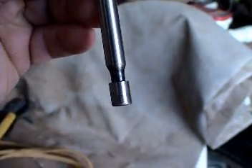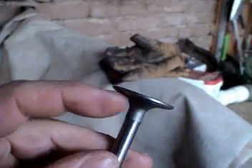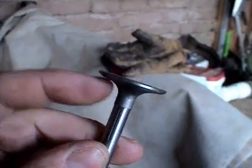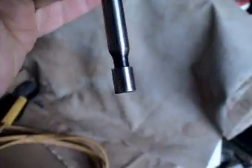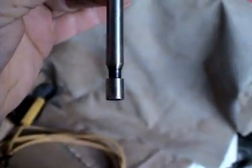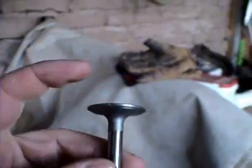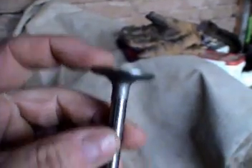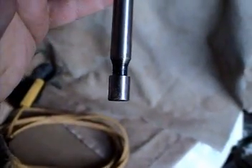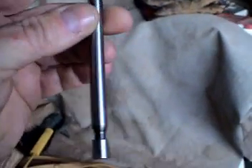So I grind a few thousandths of an inch off the bottom of the stem, and then I'll use a lapping compound to seat the valve onto the engine, and then I'll test for the length again because the lapping compound will sink the valve a couple thousandths of an inch. So I'll probably have to grind the bottom, put the lapping compound on, seat the valve, and then it'll likely be that I'll have to grind the bottom again another couple thousandths of an inch. Do it in those three steps because I don't want to make the thing too short.